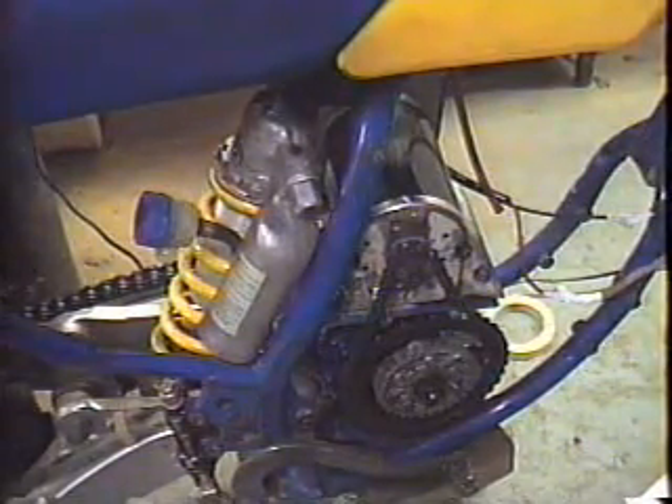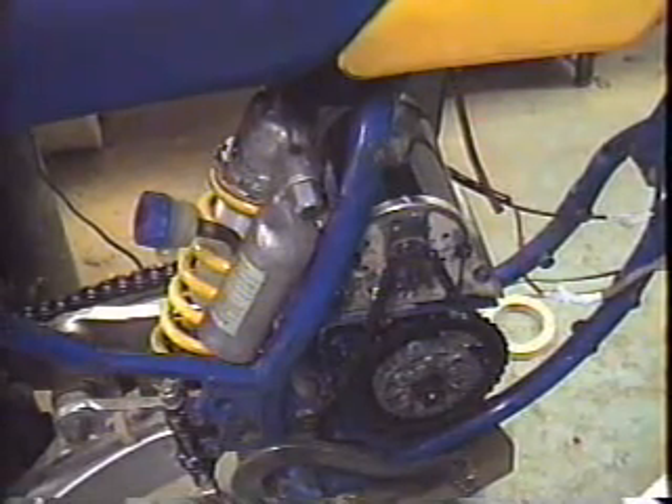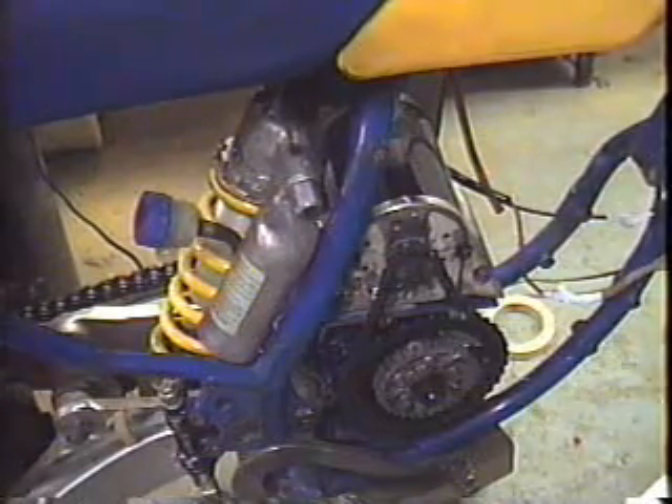When the project is done, the motor will be completely rewound in terms of the armature, will have heavier copper put onto it, the brush plate will be upgraded substantially, and the motor should be slotted and have active cooling added to it. With those new parameters I should be able to push 48 volts 75 amps peak, which is pretty much the limit of the controller. That's going to give the bike roughly the same performance as a 50cc gas engine — 3.5 to 4 horsepower, maybe 4.5 horsepower tops.